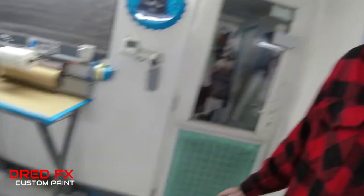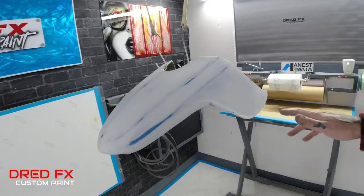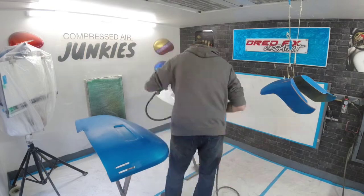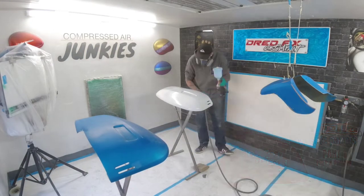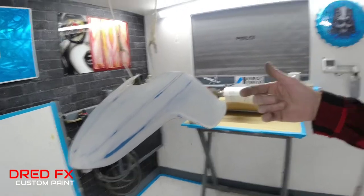Gutted the studio as you can see, so we're all cleaned down and ready for the next stage. Now I worked over the weekend, got all this prepped. We've got the front fender — I left you off in the last episode where we put the primer down. Now I've knocked this back 180, 320 and then finished off on the DA 500. So I've knocked all these down to 500.